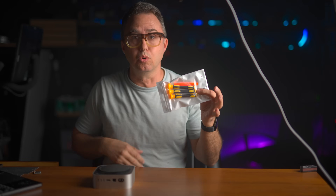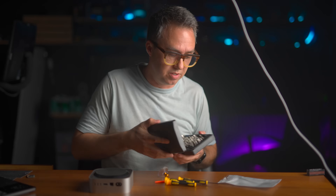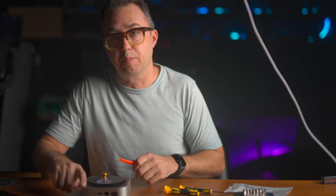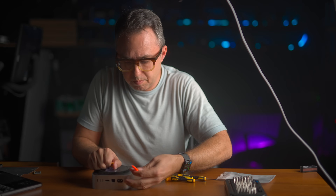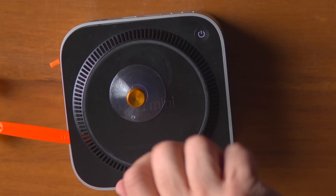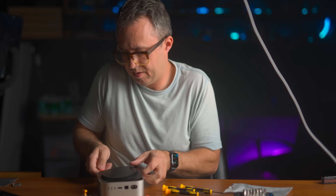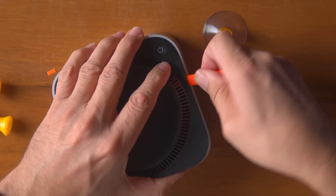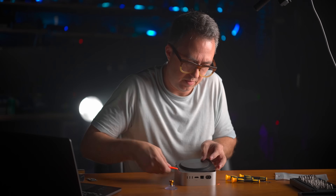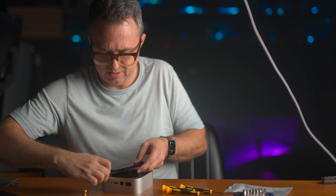Now we've got to get into this thing. The kit I got from that shop sent a bunch of little tools, including a suction cup. I've seen a few other Mac Mini teardowns and nobody has used this method. I also have this iFixit kit with all the right screwdriver sizes. Get the suction cup stuck on there, and then on the opposite side from the power button, use the suction cup to pull up on the case — that'll help get a tool in there. There's a ribbon cable connected to the power button, so we're going to keep that connected and just tip the lid. There we go.